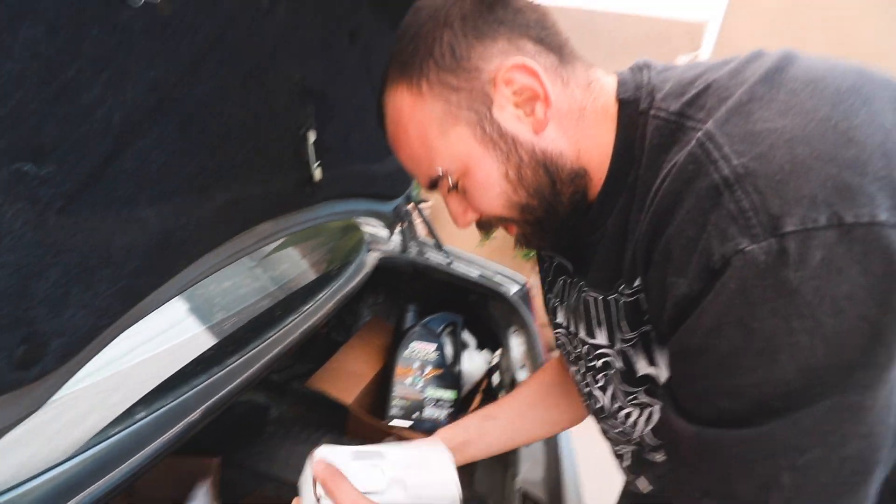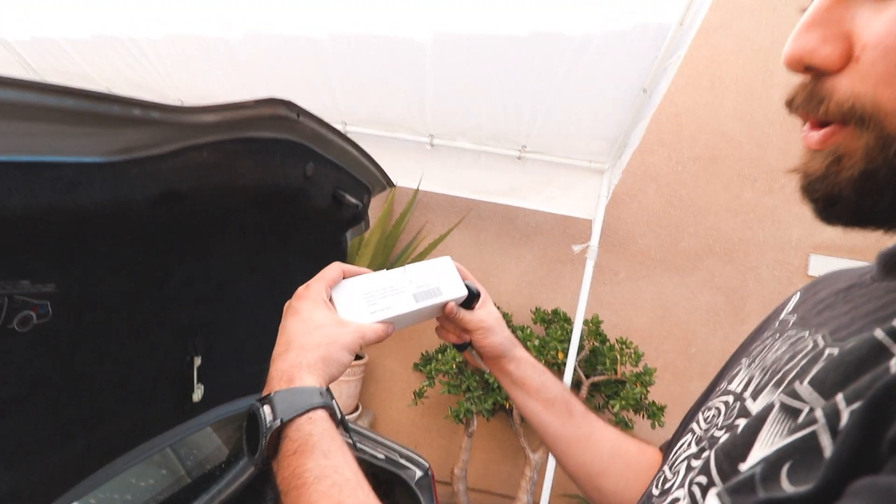So what did we get? Electric fuel pump only, used for gasoline fuel injection systems. The fuel pump that Martin did get was a Walbro 485 fuel pump, which can handle up to 600 wheel horsepower on E85 and 850 wheel horsepower on gas. So 850 on gas or 600 wheel horsepower on E85.